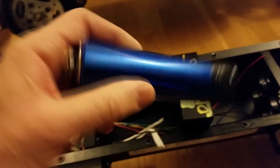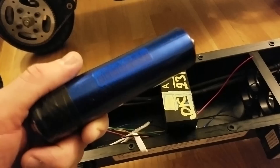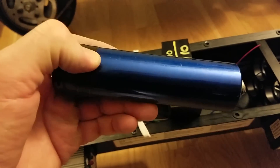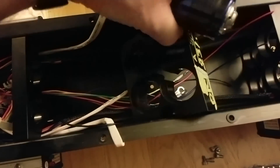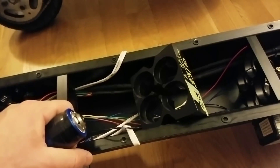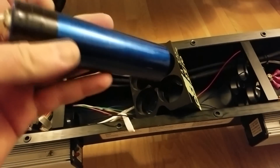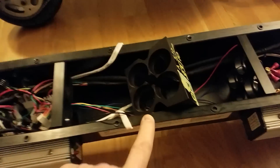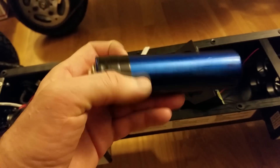Why are these wires like that? And why are these brackets placed there? So then I realized the Baha board was actually using lithium phosphate cells. This is a cell I bought about four or five years ago for my first projects — it has 12 amps and they don't have high discharge. But if you buy them now, the red colors, they can actually discharge 100-amp cells. The system was eight pieces put here — four here and four over there. So eight multiplied by 3.3 volts, that's somewhere between 26 and 29 volts. Not enough power, I think. And the highest they had when I checked a couple years ago was 18 amps. So I don't think this board ran for too long or had a lot of torque, because they're not designed to discharge a lot of amps.